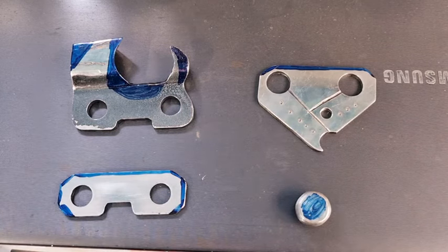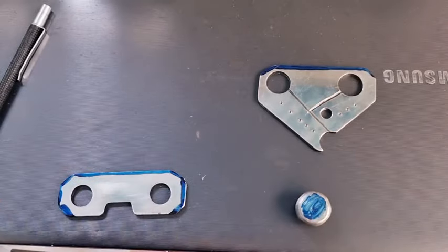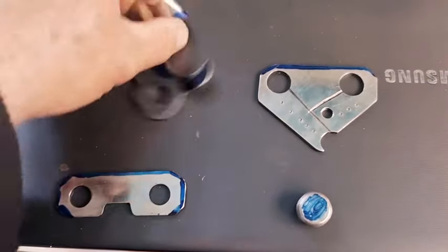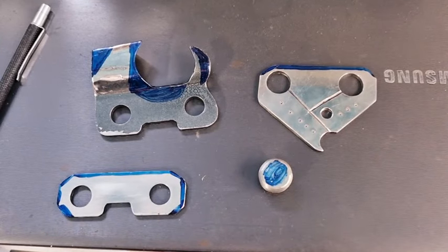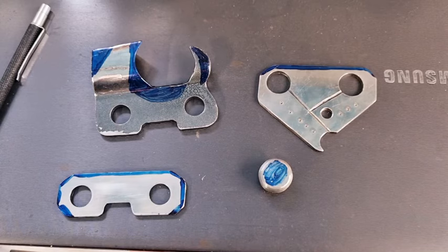Let's briefly go over that again. Where I've got the blue marked, these are all the parts that are removed — excess metal taken away so you're left with a bare minimum, a small tooth. All along the tie straps highlighted in blue, and they'll thin out edges where possible. With the rivets, after they grind them down they polish them. Because if they're polished to a high finish, there's less resistance and they'll be much smoother going through the timber. You can learn quite a lot from a racer about chain geometry, and the best chain out there is full chisel, square ground.